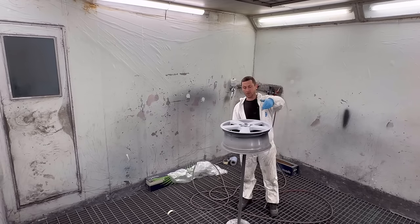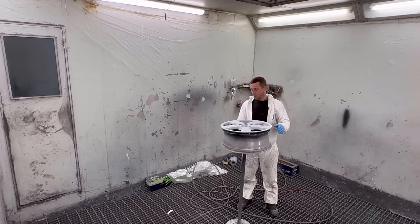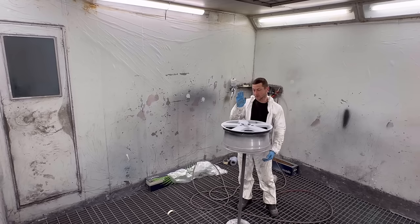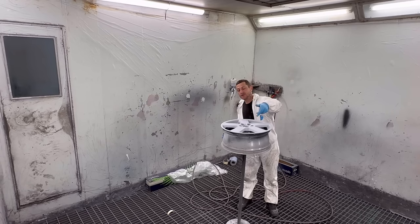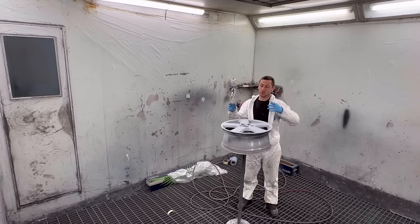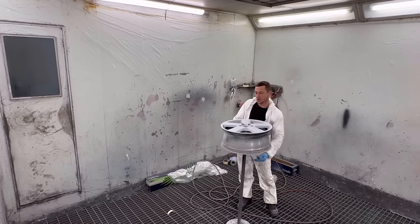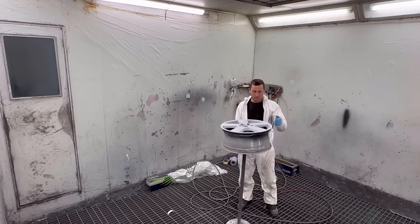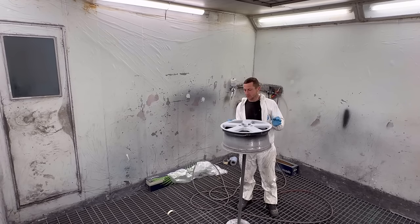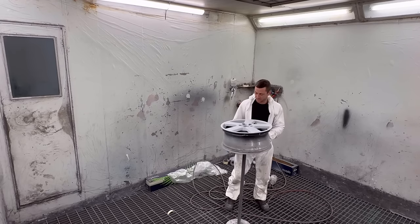The way I like to paint wheels: I'm going to put colour on the top — a light coat, just a covering coat — and then while that's flashing off, I'll give the inside one coat. By the time the inside is done, the outside has started to flash off, so I go back on with a wet coat. That way we can do it all in one go: little coat, wet coat, wet coat. If you guys have seen the channel before, you know what colour the wheels are going. Some of you are new — they're a bit like Marmite. Big shoutout to my friend Mark; he absolutely loves this colour on wheels. This one's for you.